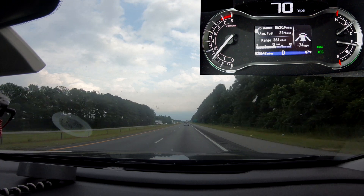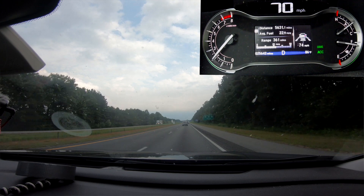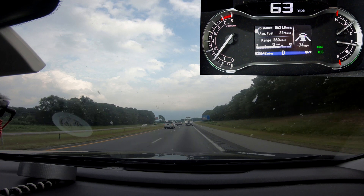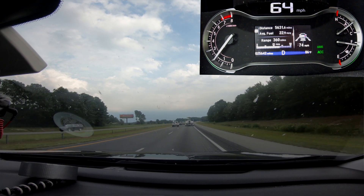Another concern is that sometimes the adaptive cruise control is a little slow in recognising a vehicle. Right now it can see the vehicle in front, but we're catching up pretty quickly to this boat, and I suspect the car in front is going to go around it. There it goes — now the adaptive cruise control doesn't see what's in front of me and we're getting pretty close. There it is — it's come on and slowed me down quite a bit. With slower moving objects, particularly larger or oddly-shaped ones like the back of a boat, it sometimes struggles to recognise them. You end up going quite fast toward another vehicle, then it recognises it and slows you down pretty quickly — sometimes really slamming on the brakes. It's a bit of a game of chicken, but I always try to give it an opportunity and it pretty much always works. You just may want to cover the brake in that situation.